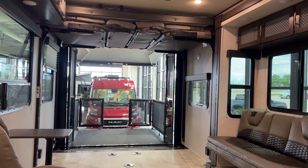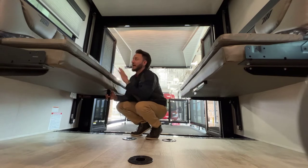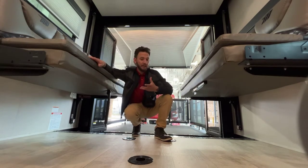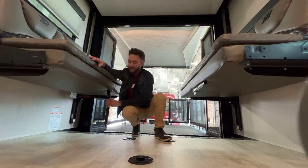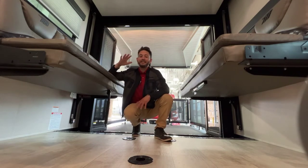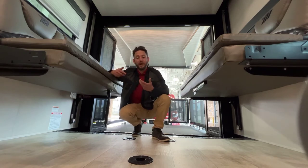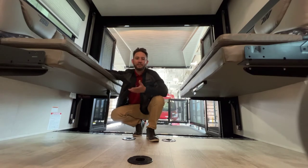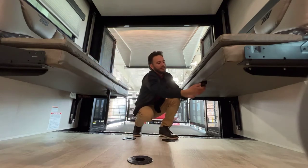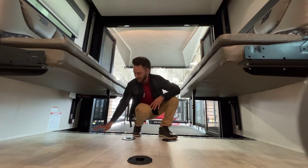Make sure only one side catches — bring it up until both sides go up. Now remember, folks: this has a 600-pound capacity for the Happy Jack system, and that doesn't include these sofas. So subtract about 150 pounds for the sofas, leaving you 450 pounds. You definitely don't want to sit on them when they're going up or down, and you don't want kids on them either. If you want the best and longest use out of your equipment, don't hang on them or sit on them while they're in motion. And don't forget to use these handy dandy braces — they are there for a reason.